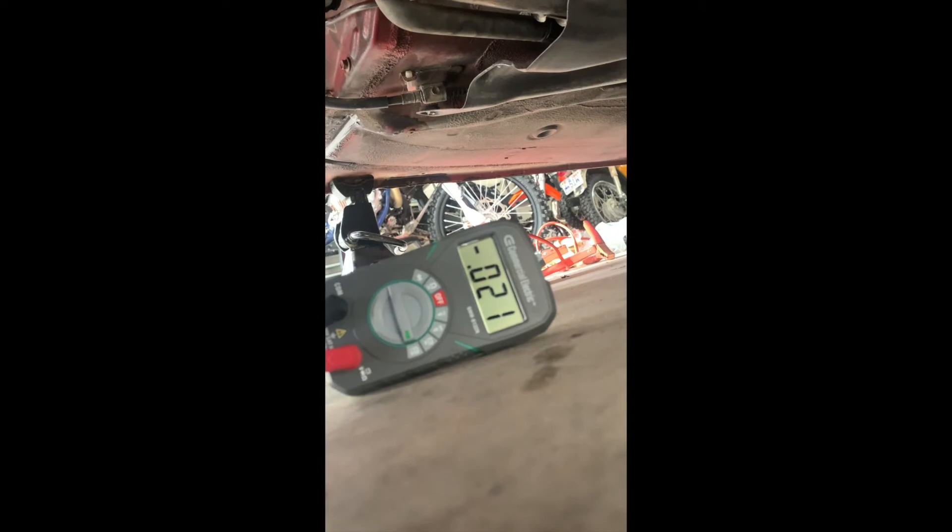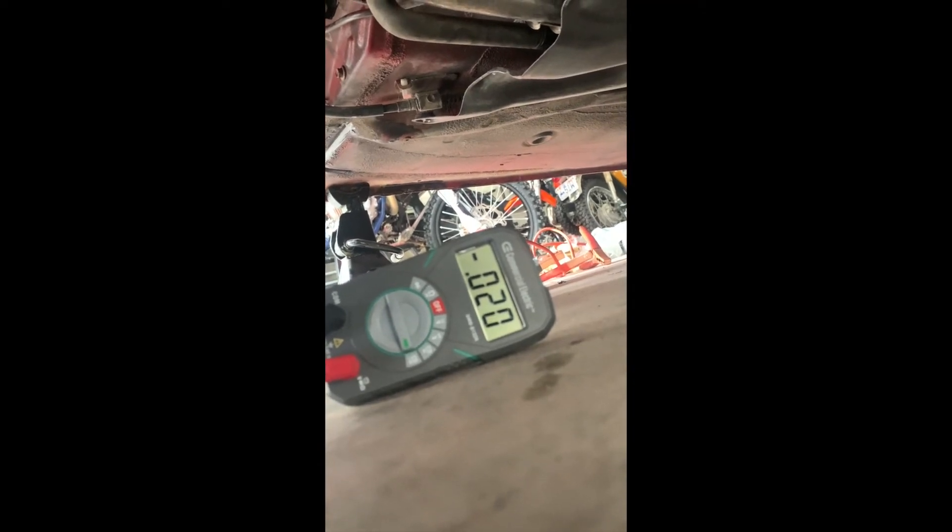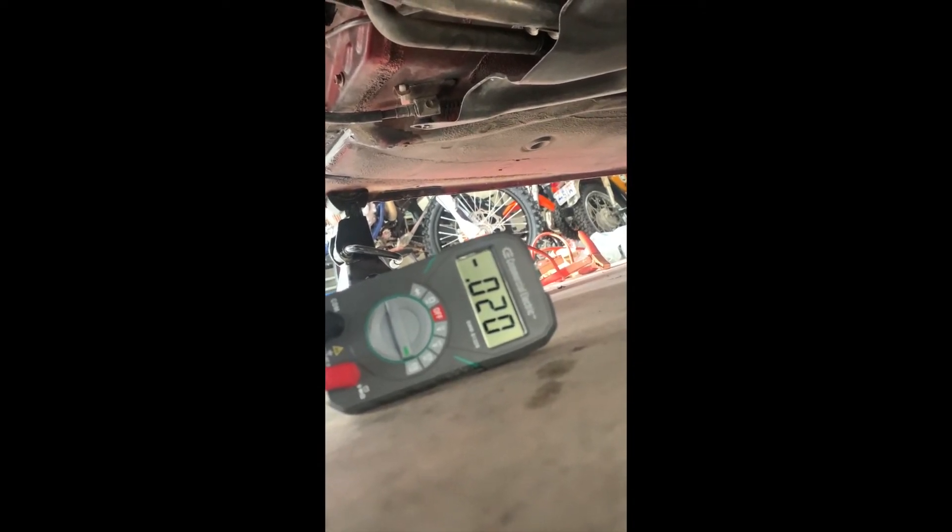I put it back together but it's not starting, so I'm still assuming there's no spark because I can't see RPM. I've been having tons of problems trying to get this thing started. Just made a connector change on the crank position sensor — recording this just because I'm hoping it starts, or at least tries to, because it hasn't for four days. Here goes nothing.